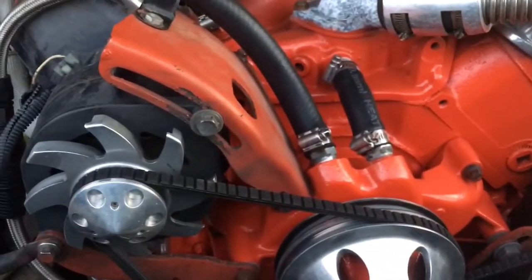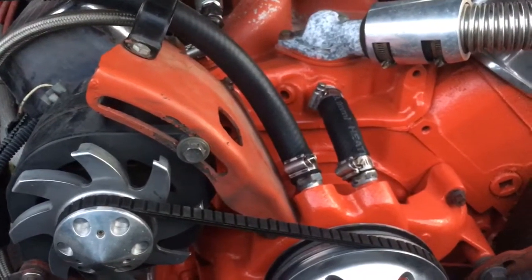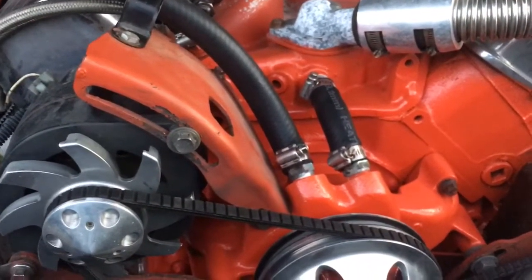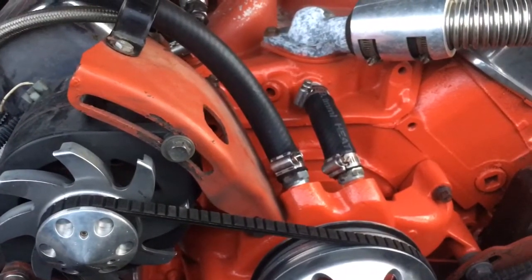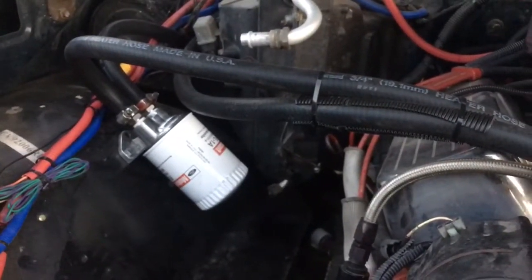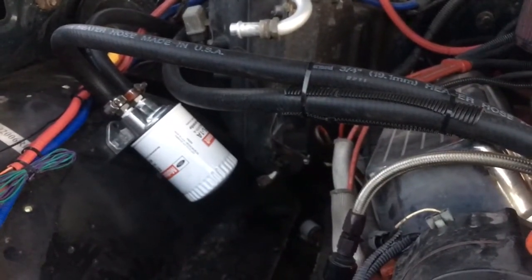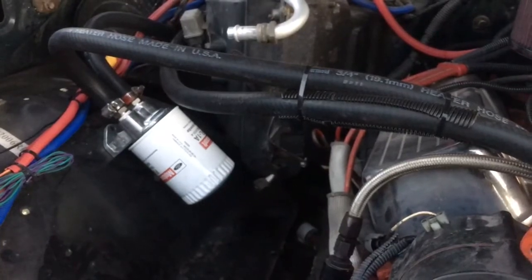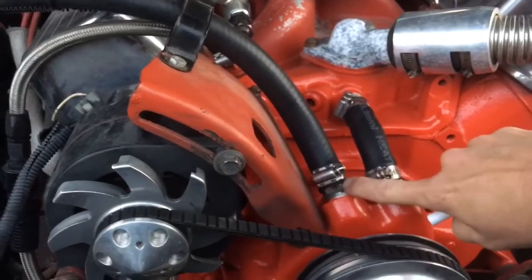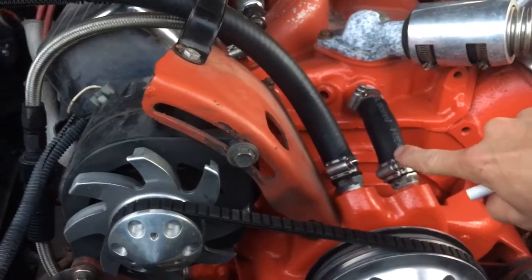This video is concerning the correct water flow between the engine and the heater core. After I took the water pump off, I noticed that every time I drain the coolant on this thing, I always have some type of debris inside the coolant. So I wanted to install a coolant filter. I figured the easiest way to do that is to use the heater core lines and run an off-mount oil filter in series. What I had thought was that these two lines coming from the water pump were an outlet port — but they're not. They're a return to the pump.